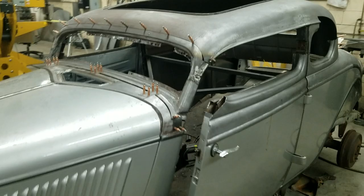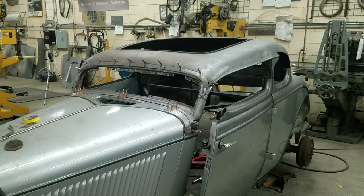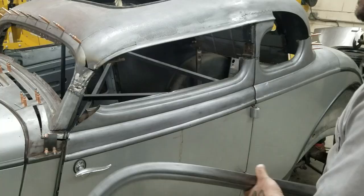It's a lot of work to get everything cut and put back together — that is a pretty small windshield area. Yeah, you have to cut the header out, cut the cowl out, lay the posts back. I mean, it's just a nightmare. You can see the difference in the door angle — it's not even going to be anywhere near what it was.